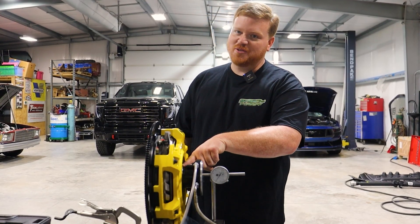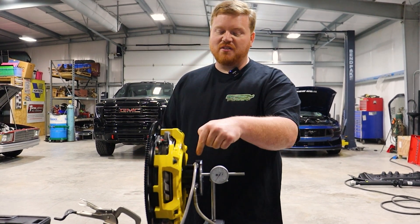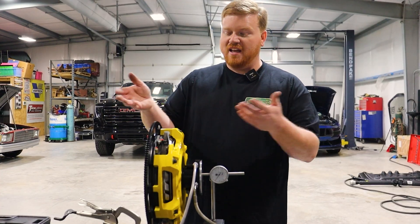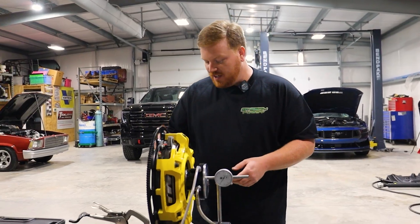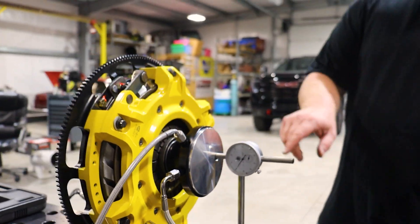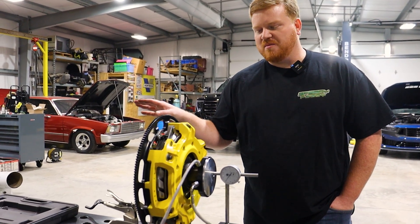Keep in mind, this bearing is always touching these pressure plate levers. I've actually modified one of our release bearing bases to have a hole in it, as well as this apparatus that we made just for having this on a display. The whole point of this display was that someone could walk up, hit the clutch pedal, and actuate this clutch at PRI. I put a hole in it so I can contact the backside of the piston with an indicator and show you how much travel this thing has.